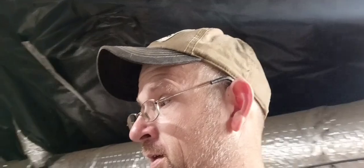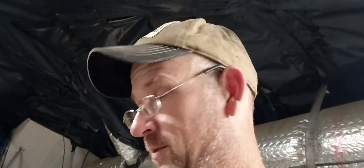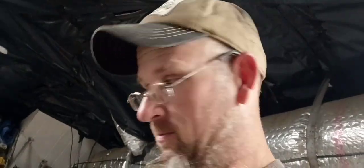I do have the timing cover on. I kind of skipped over that. It's pretty basic stuff, guys. I just sprayed a translucent layer of RTV on both sides and bolted it on. And I figured I'd start on this oil pan. I was going to video this process, and I'm glad I mocked it up before I started the camera, because there were some awesome, nice words when I started this.